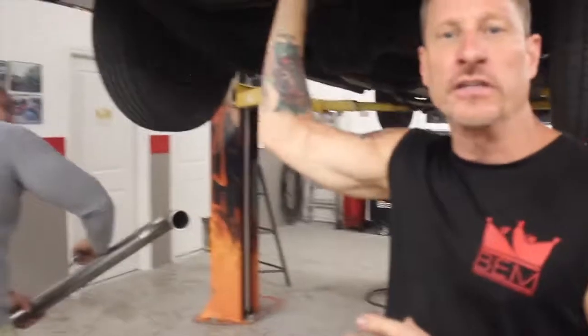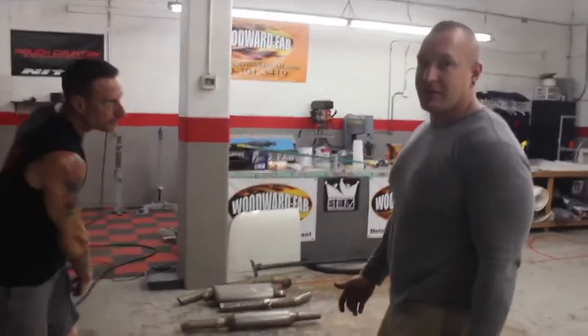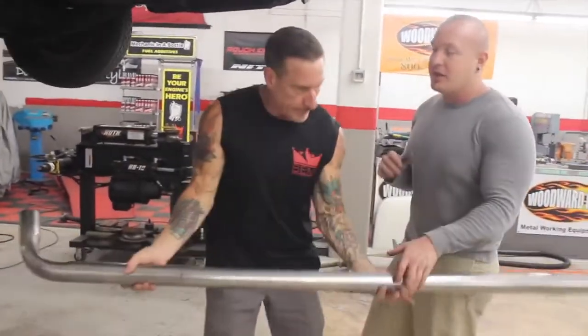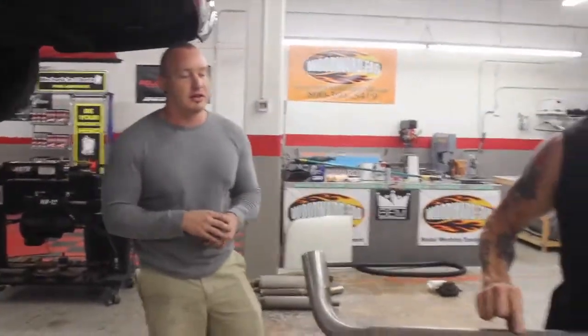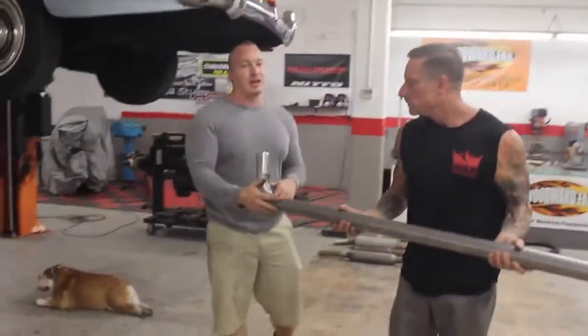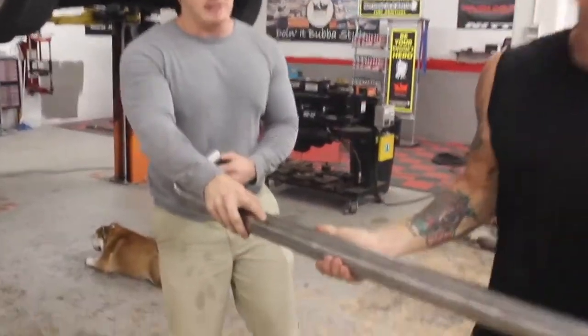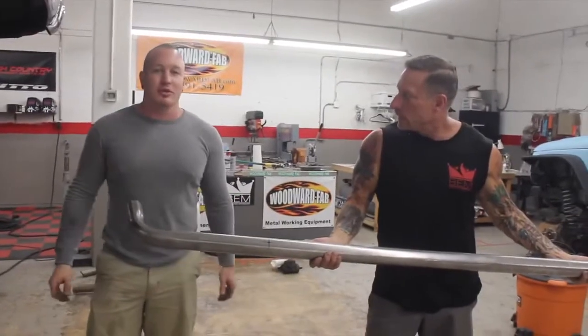We're going to bring you an update. The Master's been at it for about two hours now, custom fabricating this exhaust for the 1965 Rolls-Royce. Everything from the Y-pipe all the way back to post-muffler is now fitted, welded, sealed, mounted, and done — absolute perfection with clearance everywhere. Now I'm working on the over-axle pipe, from the outlet of the muffler to the over-axle section, starting with an 85-degree bend out of the muffler. My next bend will be about 75 degrees to turn it toward the rear of the Rolls and get this thing flowing out the back to build that true dual look with a nice chrome tip when it's done.